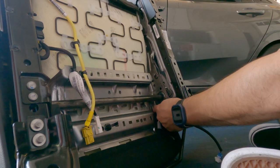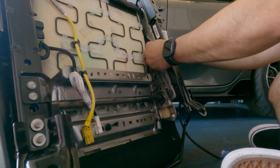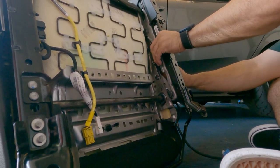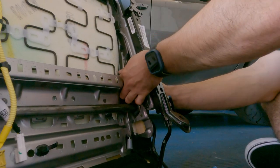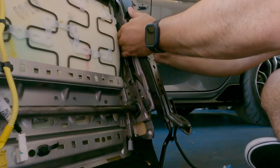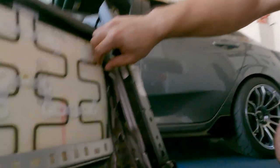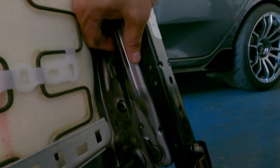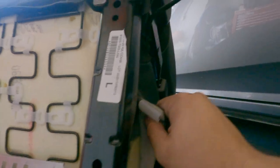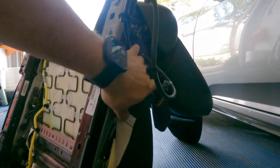To maintain all of the original harnesses and sensors, I had to unhook these little clips for the seat belt. I wanted to make sure that every single sensor still installed correctly into the new seat — no dashboard lights saying the seat belt isn't buckled, and to make sure the SRS airbag sensors are still working properly. The seat belt had about four to six clips connecting from the bottom bracket all the way up to the seat belt itself. They're a bit hard to reach at first, but if you sneak your finger down into the backside, they pop out fairly simply.